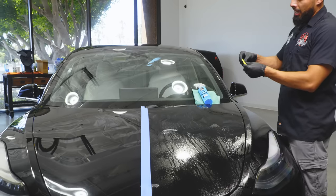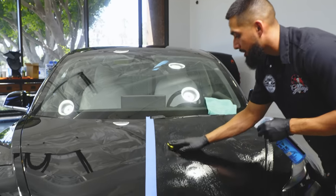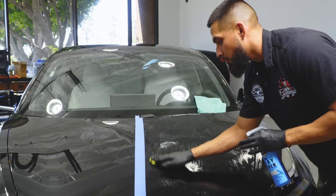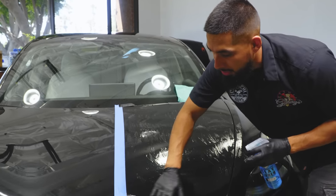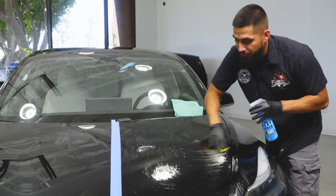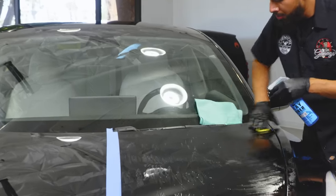In this case I'll re-knead the clay bar and continue with another clean side. How you know when to toss it out is whenever you remold your clay bar and can no longer get a clean side. If you do two to three heavily contaminated cars, just toss that piece and come back with a new piece for the next car. Whenever you're gliding the clay bar across the surface, you start feeling the contamination pull off — it gets smoother and smoother.